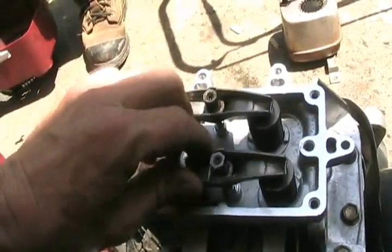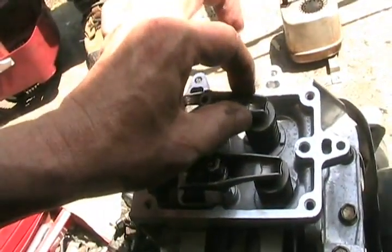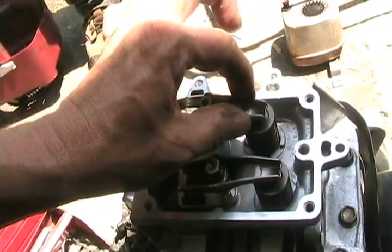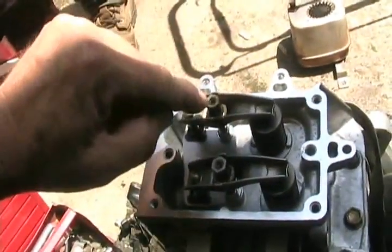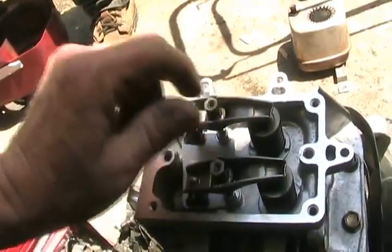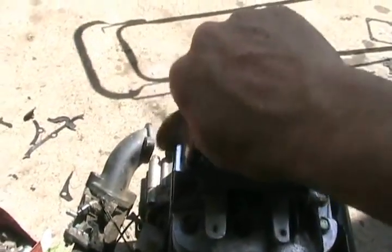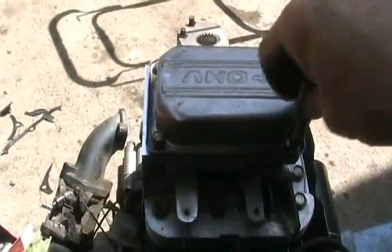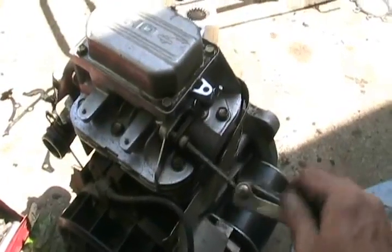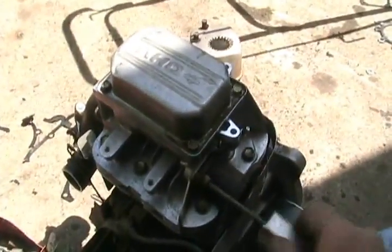This one's set right anyway, but this one's not — it's really loose. It has a little bit of sideways rock and about ten thou of up and down. Now both are set. I'm ready to put the valve cover back on — I've already got the new gasket on it. Spark plugs in. Now I'll tighten the exhaust manifold. Cover's all tightened down evenly.